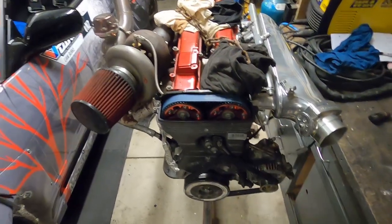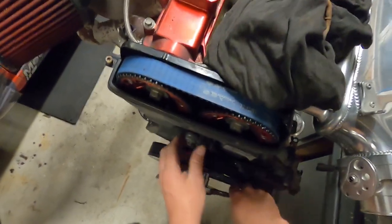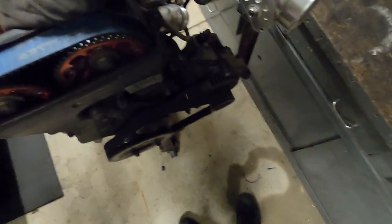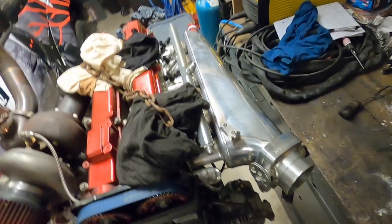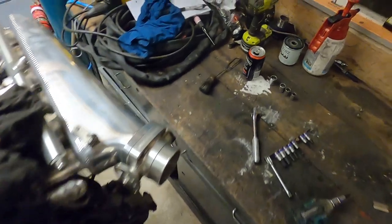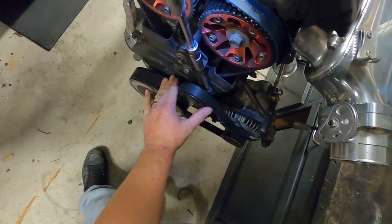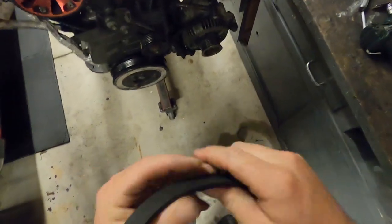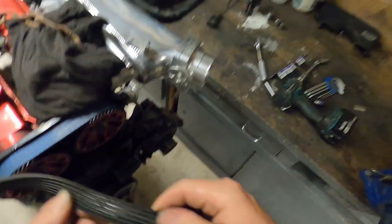Let's get all that gear off and start going into it. This is a custom-made tensioner using a Subaru bracket — got two big long pieces in there, custom mounted. We also moved the alternator because the alternator wiring was melting going past the turbo, so we smashed it over to the other side and it's been pretty mint. There's a reverse thread from memory. The idler is squeaking and you can see it's going shiny in the middle grooves — usually pretty toast when that happens.